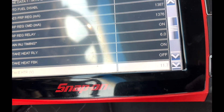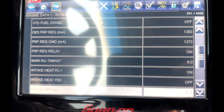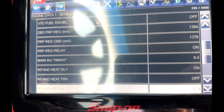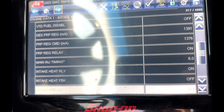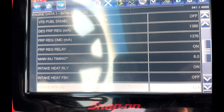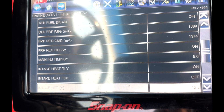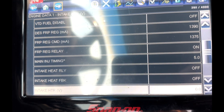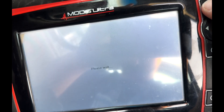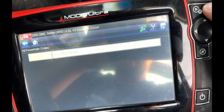I'm using my phone now — my GoPro just died. I just started the truck up cold. The intake air heater relay is on and we also have heater feedback voltage. The truck's doing it all naturally. The intake air temp is about 37 degrees — it's a nice cold start. I just want to make sure this thing runs through its deal and everything's good. You can see it's actually working now. Once it shuts off — intake air heater relay off — we'll check for codes and go check the DTC status. It just shut off. Let's go back — codes menu — we have no codes present.